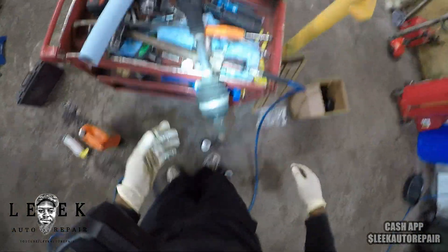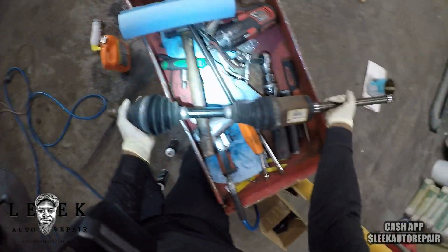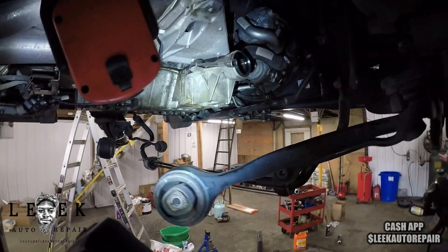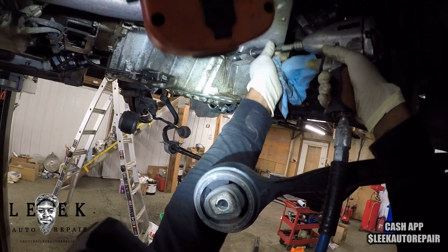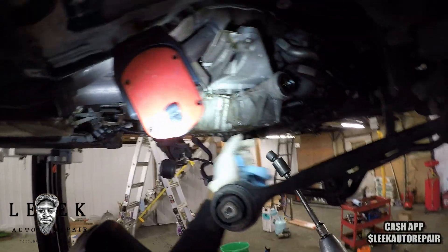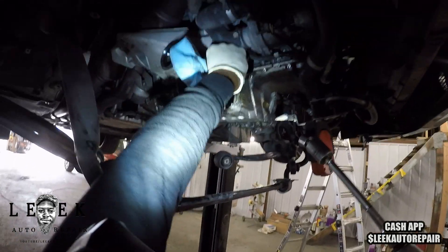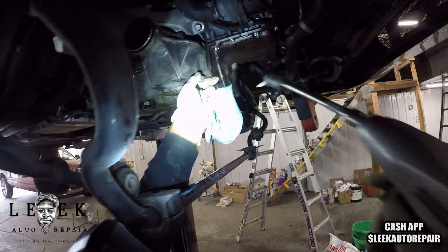This axle was a little floppy. There's a certain way you can straighten out an axle — you kind of stroke it into position. Next, I'm taking off the little housing for the axle — the adapter that goes into the oil pan itself. That's held in by 13 millimeter bolts. As soon as you get those bolts out, grab a pry bar or something flat and just lightly pry it out, or use a rubber dead blow and lightly tap it. These bolts don't have to be that tight.